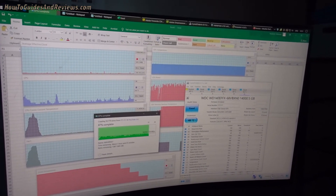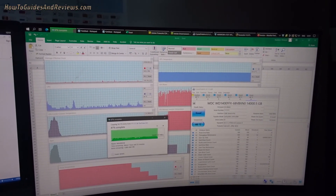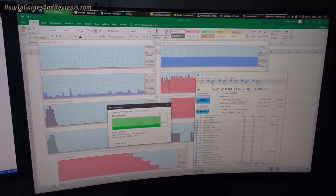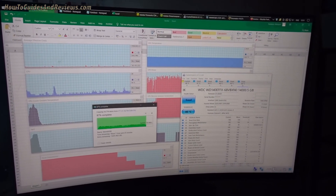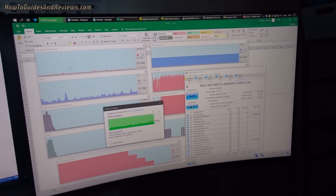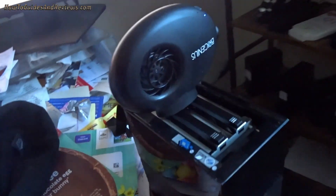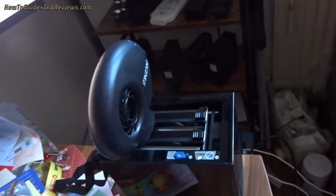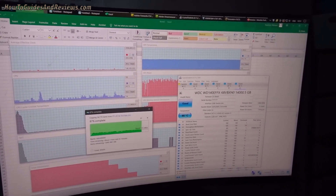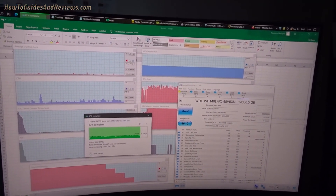At 50 degrees is the danger level because you're shortening the drive's life. No matter what Western Digital or anyone says, once your temperatures start going over 50 it's shortening the drive's life. You can't say by how much, but the higher the temperature the shorter the life, and the greater the risk of sudden failure — especially if you're seeing above 55.